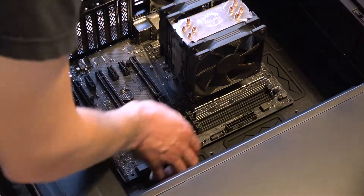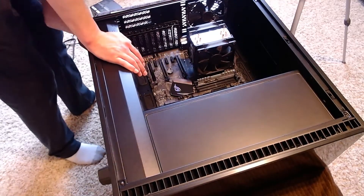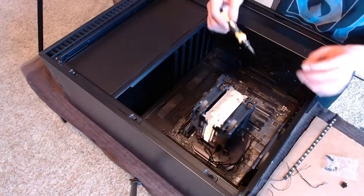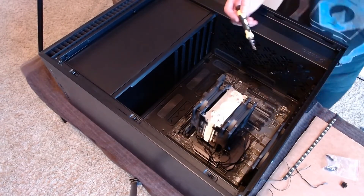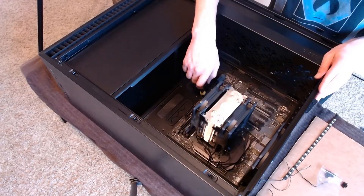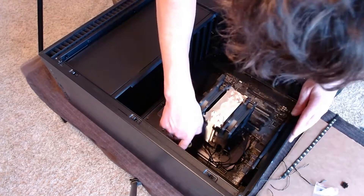Go slow with this process. Line up everything like your life depends on it — this is a puzzle piece that only fits one way. After the screw cutouts are lined up, we can secure the board and start screwing. It's important to provide just enough force; there is no need to over tighten anything. Every computer case will come with its own accessories, and sometimes the screws to mount the board can be different sizes. In this case the screws are larger, higher quality screws.